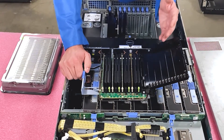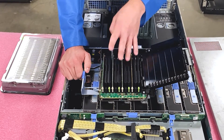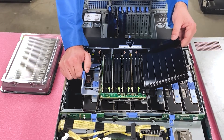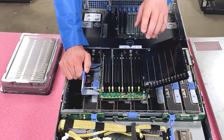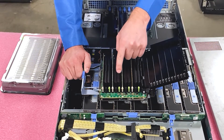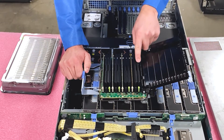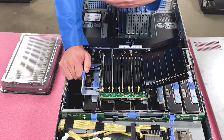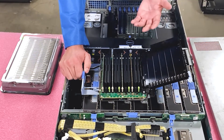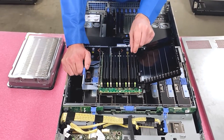Now I'm going to show you how to actually physically take them out. Right now it's literally only got four 16-gigabyte modules, and we're going to be loading it with 64 gigs for this specific customer — they want six terabytes altogether. You'll notice we have these black blanks in here. These are simply just little plastic inserts; they cost a buck or two, fairly cheap. I always recommend for data centers — if you've got a ton of Dell servers or HP servers — get some of these blanks.